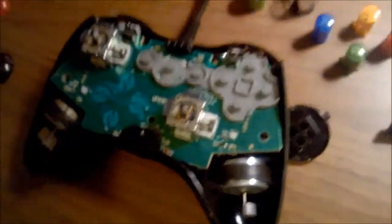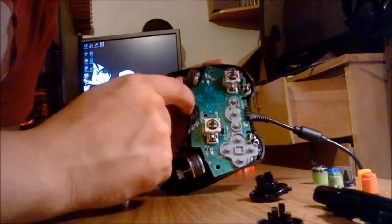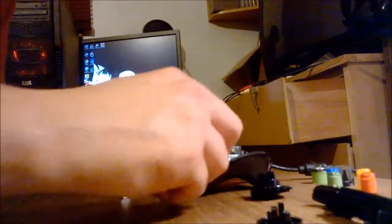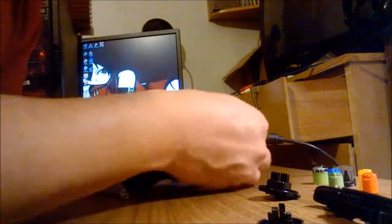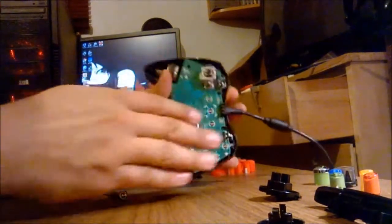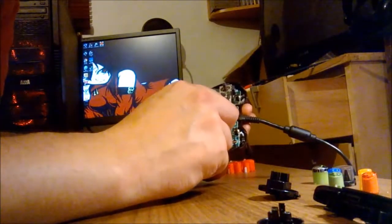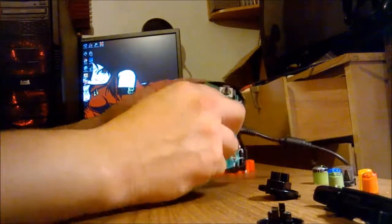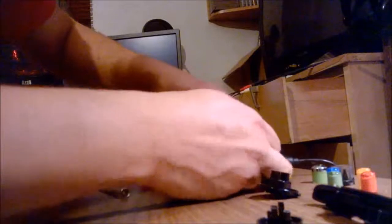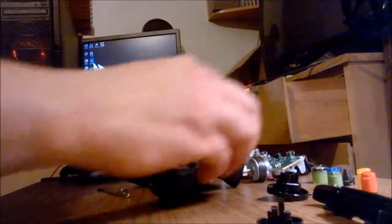Let's take you all the way inside. There's something here making it difficult to pull out - I'm going to take this rubber thing out really quick. Like I said, last night I opened up a wireless controller so it's a little different. To get the triggers out you have to slam them up that way, but this thing's here, probably to prevent me from doing that. Push the triggers, lift up, grab your needle nose pliers and slide it forward - there you have it.